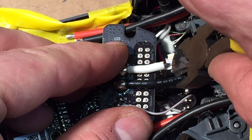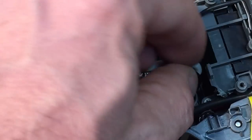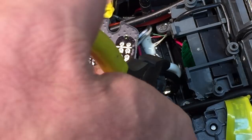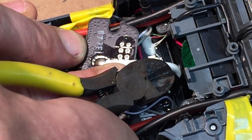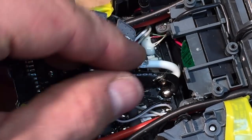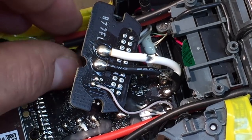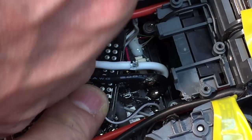I'm gonna go ahead and do the other one right here as well. I don't put these parallel to each other. I stagger them just a little bit. It makes the process for putting on the liquid tape a lot easier, actually. Do your best to not cut into the braided line inside. Just get a little bit of the rubber off. This one I got under the line a little bit. That's okay. We're gonna end up soldering it anyway.